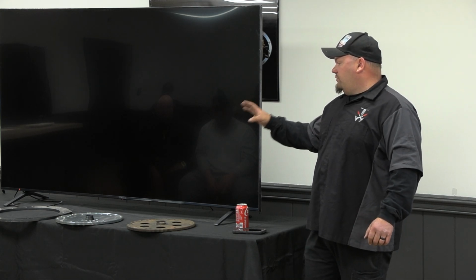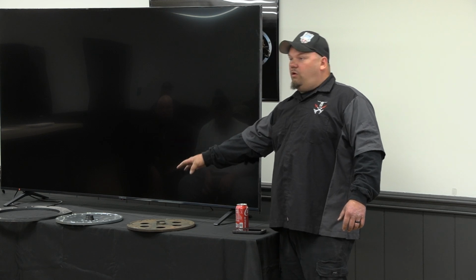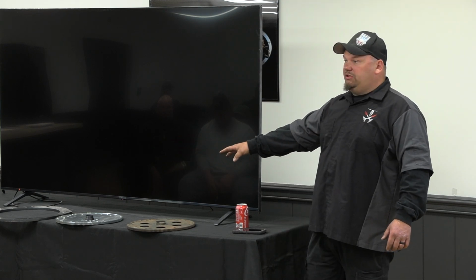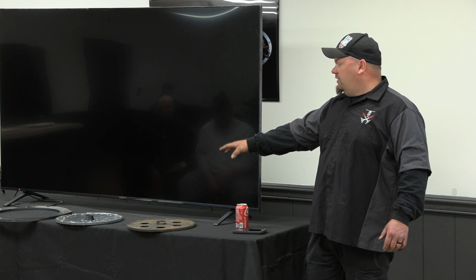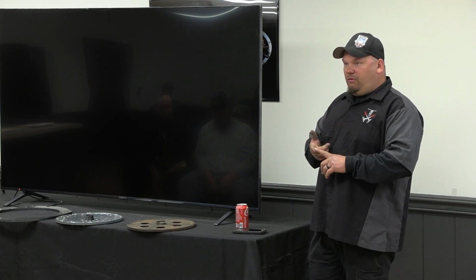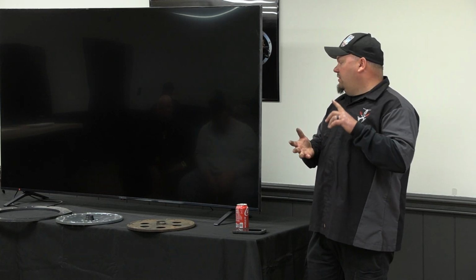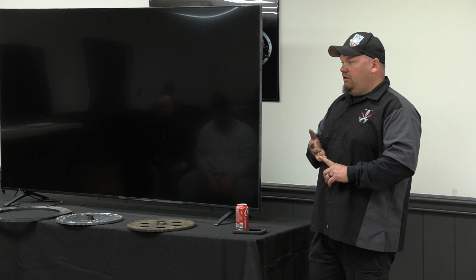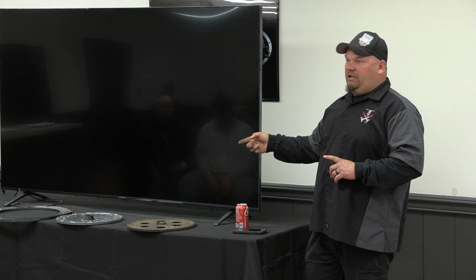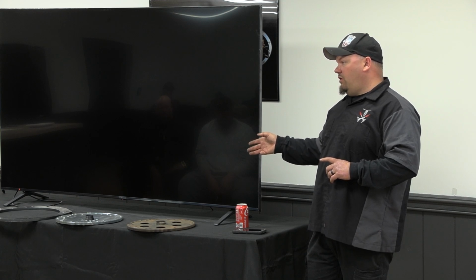So the reason we sell this flex plate, a couple of different reasons. There's 4 different patterns on that flex plate, sorry, for all the different converters: 350-400 converters, 4L80 converters, the 6 pattern ones, the 4L60 converters. Also, it's a solid flex plate. It's an SFI drag racing certified flex plate, chromoly.